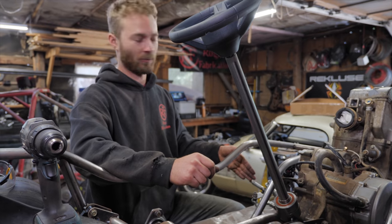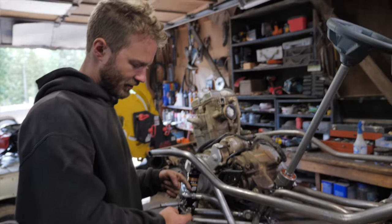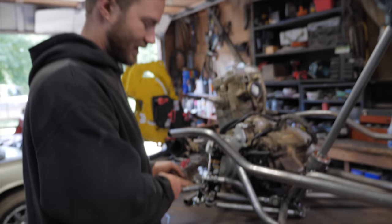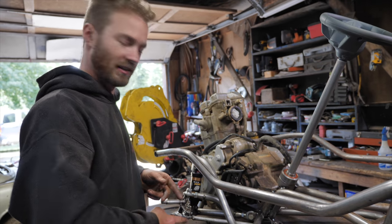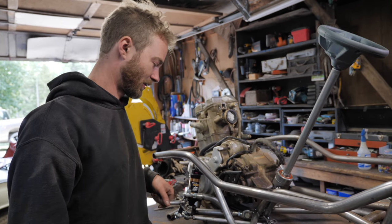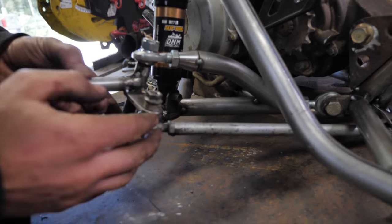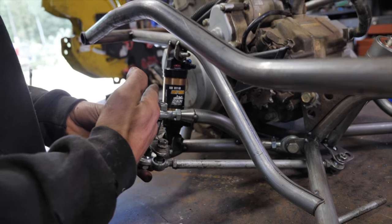I had the Ackermann completely backwards. If your steering arm is on the front of the spindle, you draw a line between the steering arm pivot and the kingpin to meet the middle of the axle — but if your steering arm is on the back of the spindle, it's the opposite. My steering arm is a lot shorter so that it fits inside the wheel to achieve that angle.